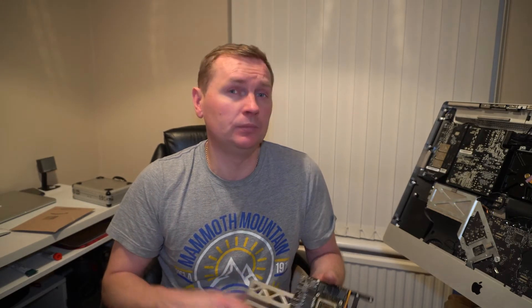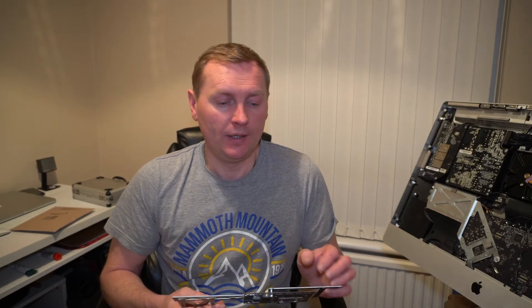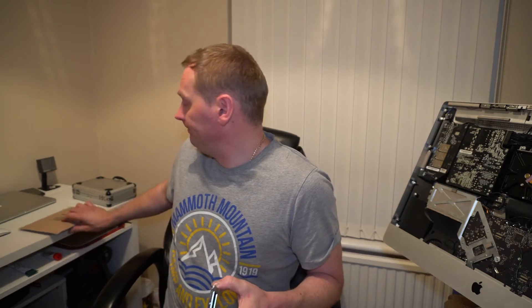At that point I bought a MacBook Pro, but I always kept thinking about that iMac — like, if better times came I'd fix it again. Day by day I watched YouTube videos and found a guy showing how to repair the graphics card by baking it in an oven. So I bought some thermal paste and took apart the computer, removed the video card, and decided to try the test. I spent only 15 euros — if it doesn't work, I'll just put it in the bin.